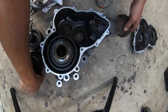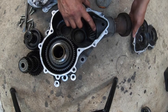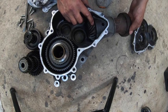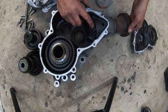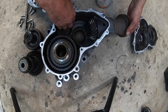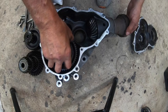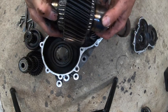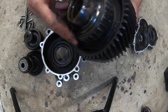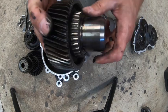To tell you the truth, not too too bad. Looks like the output shaft right there — output shaft gear. Oh yeah, another good chunk there. And here's another chunk down here of that gear. Things don't go well if these aren't properly lubricated, and the lubrication change is my understanding. This thing is right up close to the catalytic converter too, so I think that's probably what happened with this sucker.